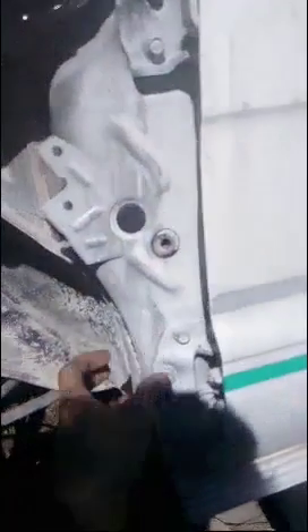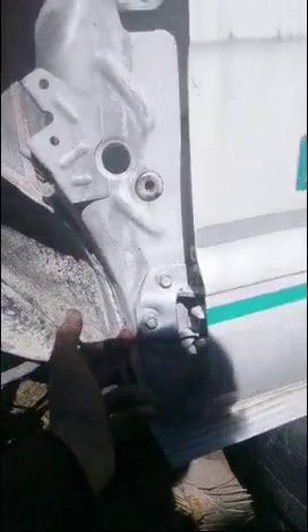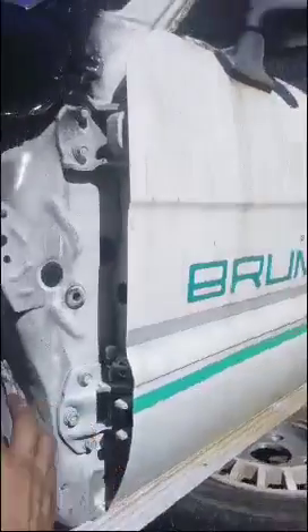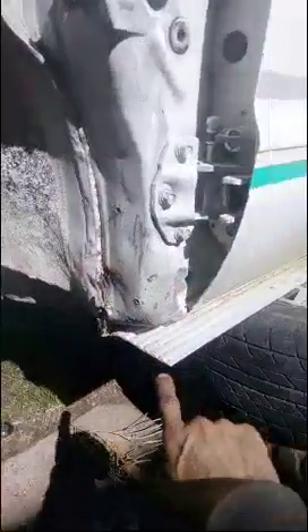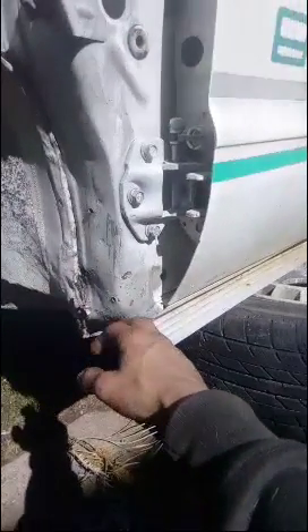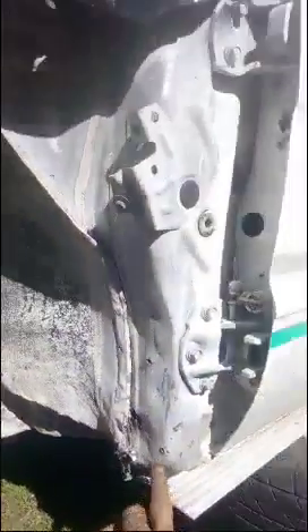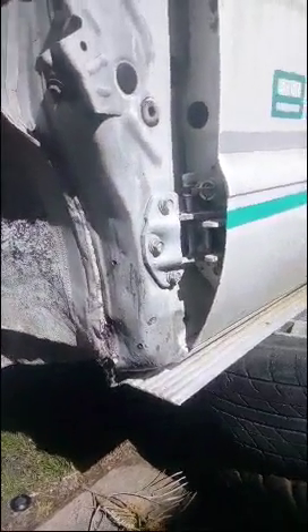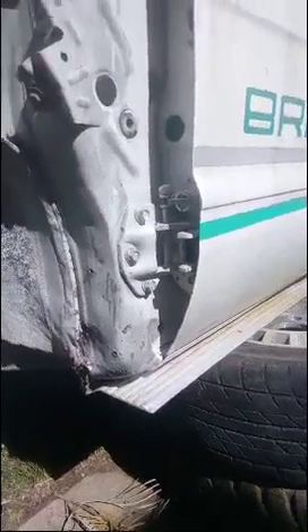When it starts rusting out at the top here, all of this goes, but then all that rusty material drips down inside and sits in there, rusting through here, and then coming down through your door hinge area — your main corner at the bottom of your A-pillar down to the front sill or rocker, and obviously back over to the chassis. So if it rusts out at the top, next thing it rusts out at the bottom too, and that's a massive problem that can be the end of most cars.